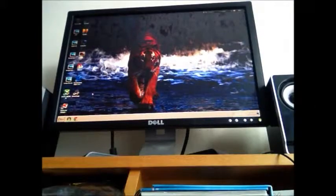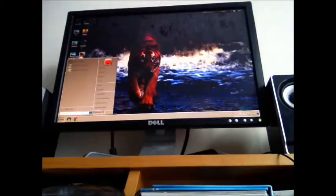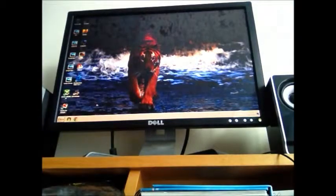Okay, so as you just saw there, I installed the drivers correctly that I downloaded from the internet. And now what we will be doing is shutting down. And then after we will turn it on again. And then we're going to change the boot settings back to normal. So let's just force shut down. Yes, of course.